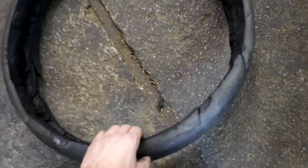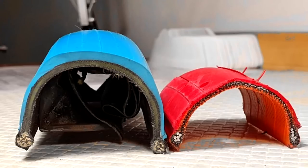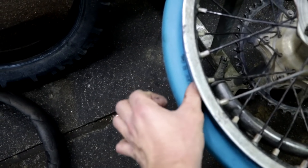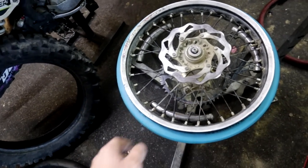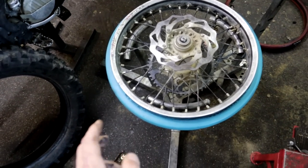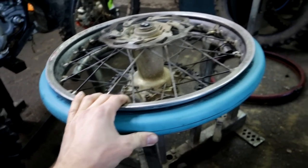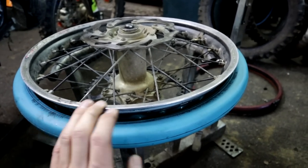Also, by the way, I used the half mousse before on my tubeless system, and when you get a pinch flat, it's saving the tire from hitting the rim. But on this system, it's not really working because the nomOusse system is already really high, and with the half mousse it's then too much, and it's not a good feeling on the bike. So I tested just with the nomOusse and it's almost perfect for me. For every hobby rider, I suggest this modification because I also tested mousses, tubeless and other products like Traxi, and nothing was as good as the nomOusse system.